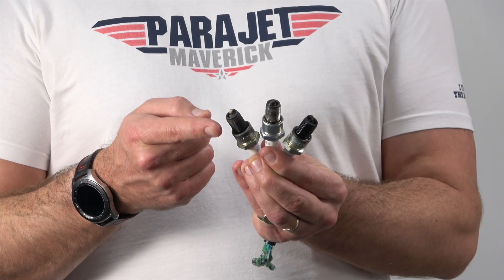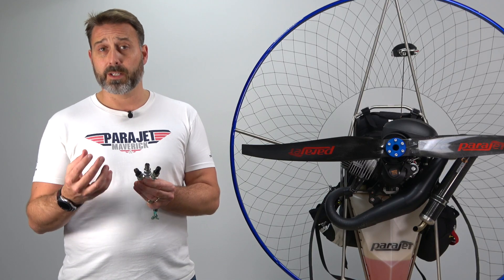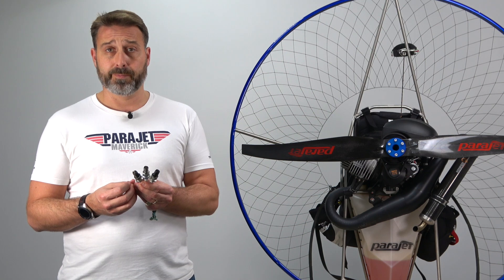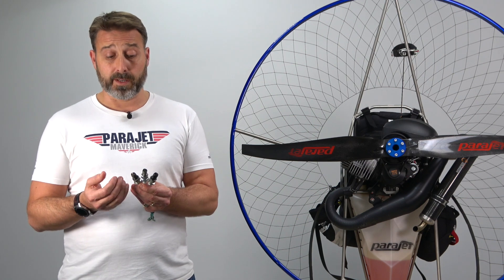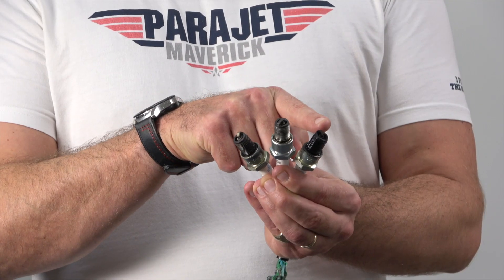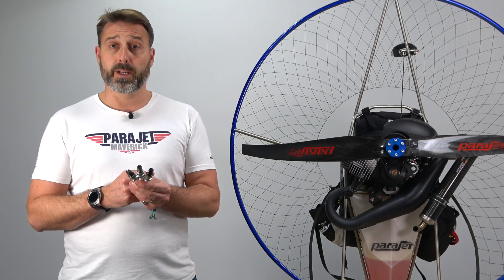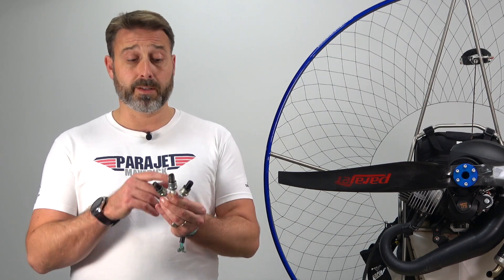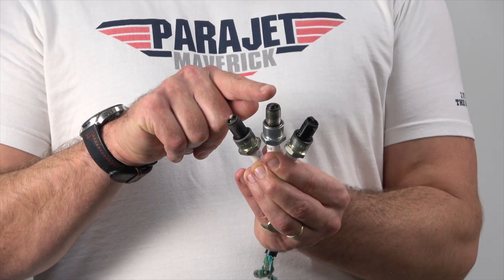In the second example, the electrode appears slightly white and extremely dry, which would indicate the engine is running hot and may be in a lean condition — in this situation it's highly recommended to stop and retune the engine. In the third example, the electrode is extremely dark and sooty and the spark plug appears wet, indicating the engine is too rich and needs adjusting. However, as discussed, it's always preferred to have a slightly rich engine rather than a lean one, and the ideal colour you're looking for is a nice coffee brown with a relatively dry spark plug.